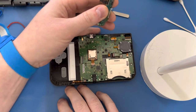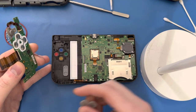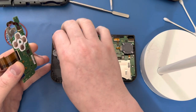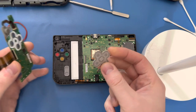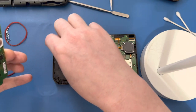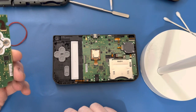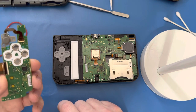You've got a clicky D-pad just like on this side of the board — it's going to be the same on the other side. Your buttons right here have a rubber membrane that covers them to seal them off from the motherboard, so any dust or debris that gets in won't get to the motherboard. Most of the time it's a tight seal. What you would do is pull off this rubber membrane, then with an air duster or a Q-tip and some rubbing alcohol, clean it out, then air dust this as well. Replacing it back generally fixes the clicky D-pad problem. This also applies to the A, B, X, Y buttons, Start, and Select — if a button isn't fully pushing in or not working, you'll most likely be able to fix it that way.